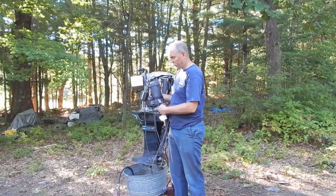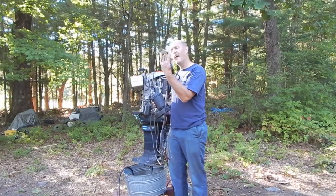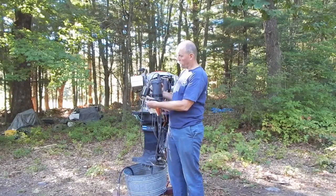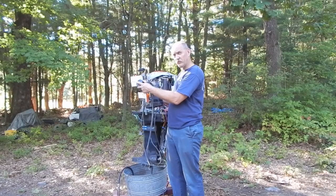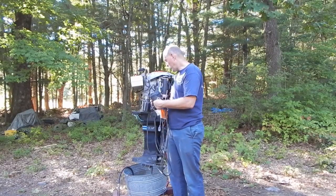The way this works is you plug the pump into this funky plug here, right? And then you plug this into your power. What happens is the pump won't run until this float switch gets lifted. When it gets lifted to a certain point, there's a switch that gets triggered inside here. There's a little weight that comes down and triggers this, and that'll turn the pump on.